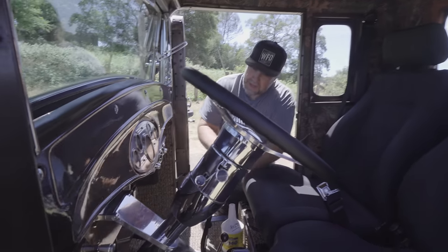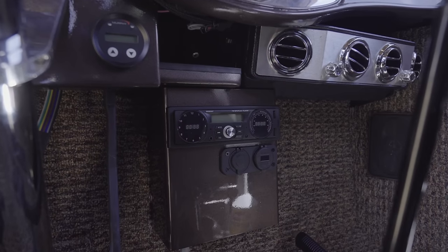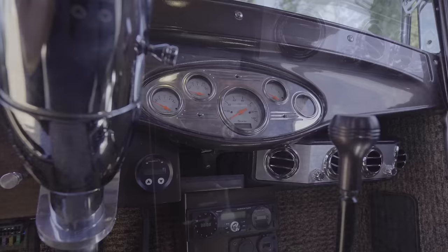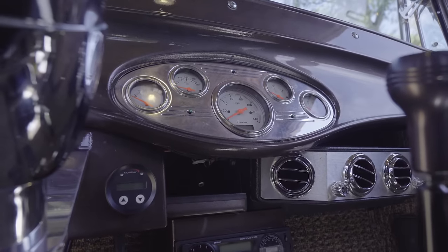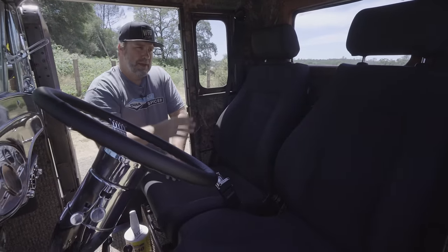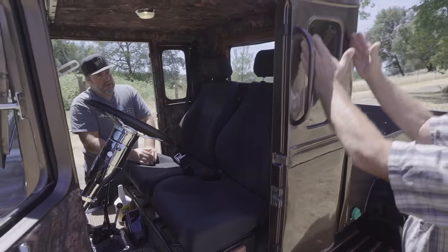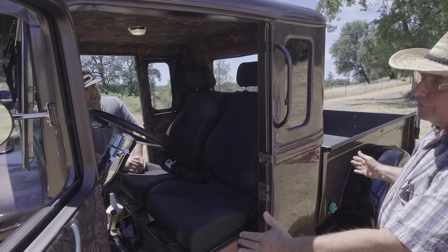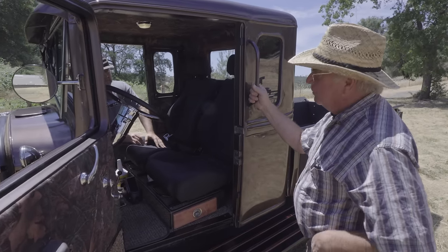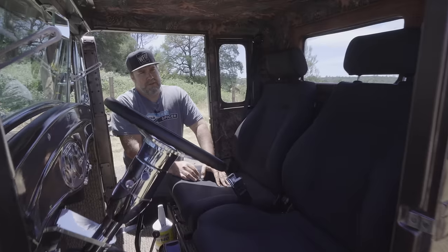That was the other key requirement — the diesel and the four-wheel drive drove this project. There's an air conditioner and heater, so you actually have working AC. There's a stereo — new, actually. They've dropped the price on those nowadays. Classic simple gauges in there. But this is not a factory cab — how much space did you add? I sectioned it and added one foot, right down where the window is, stretching the cab. In retrospect, if anyone watching is going to do something like this, think about 16 inches instead of 12, because that extra four inches counts.